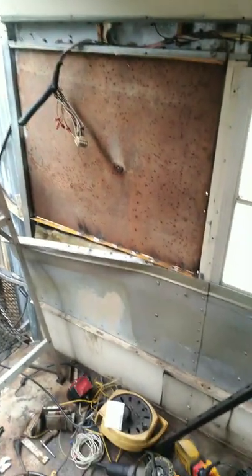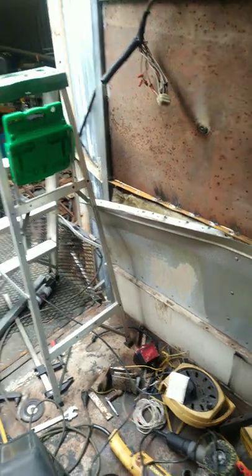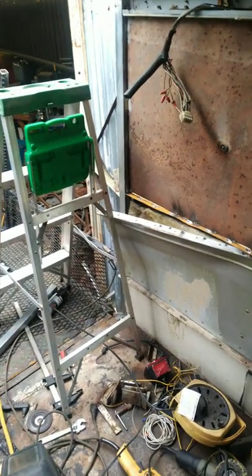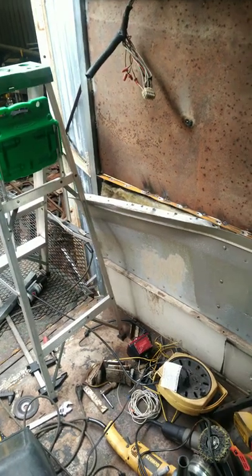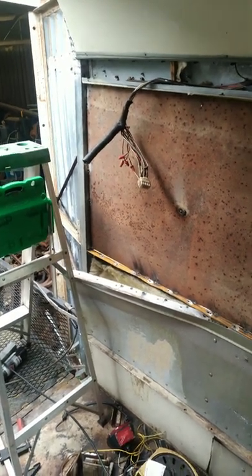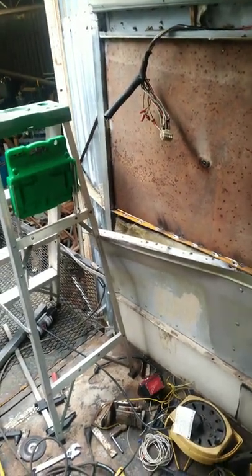...get my test light out, find my wires. There's a hole I was showing you yesterday — I need to enlarge it right in there, put a rubber grommet in to stop any chafing of my wiring. So I think that might be my thing today: find the brake lights, blinkers, headlights, tail lights, and then possibly pull my wire rolls out, run some extensions. I'll do these right — solder them, heat shrink them, put them in a housing.